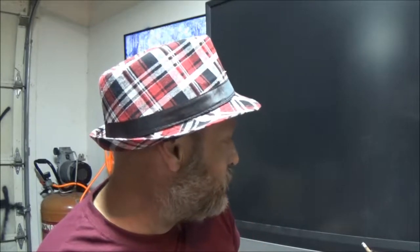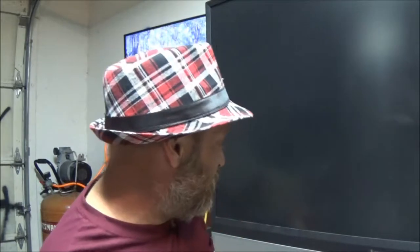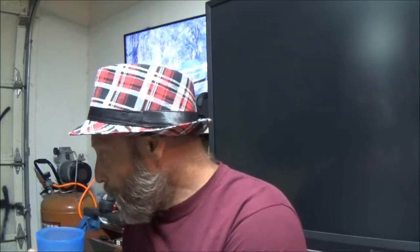She said she was using it one night, shut it off, and the next day when she went to turn it on there was sound but no picture, and then it would shut off. That could be a capacitor, but I do know on this TV you can run a diagnostic code. You don't have to have the remote control on this Mitsubishi — you use the buttons up front. I'll show you how to do that once we plug it in.